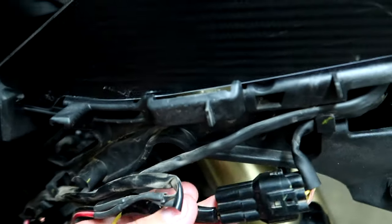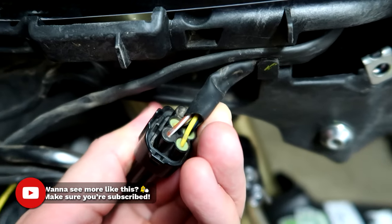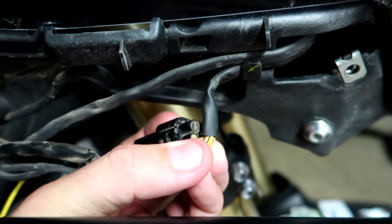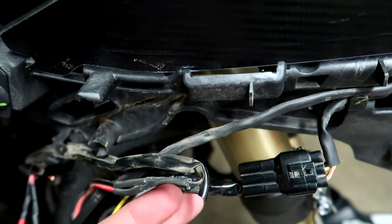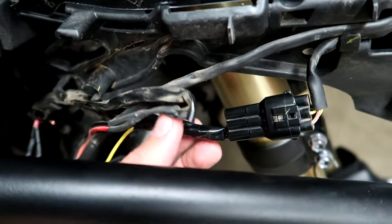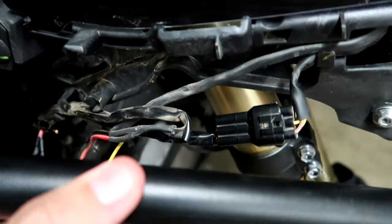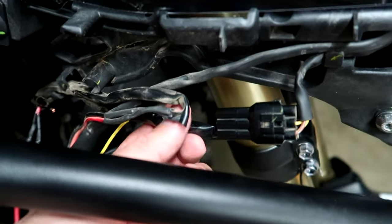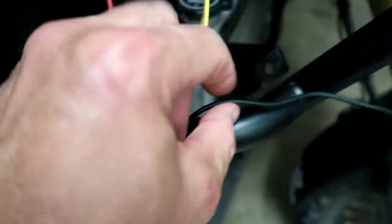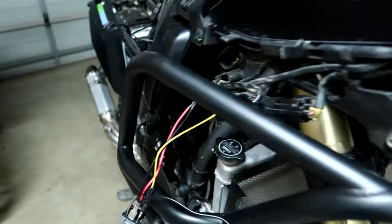The trigger wire is yellow because it hooks into a yellow wire on the headlight wiring harness plug. You can see the plug has a yellow wire, a brown, a blue, and also a yellow with a black stripe — we want the plain yellow wire. I tapped into it by cutting the wire and soldering it together with an extension wire. A lot of people are fussy about cutting their harnesses, but if you know what you're doing with a soldering iron, some heat shrink, and electrical tape, it doesn't bother me. So tapped into that yellow wire, and that one goes to the relay as well. Terminal 87 goes to the positive power for your lights.